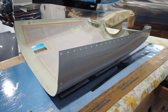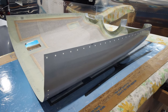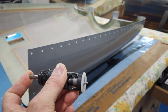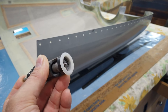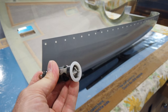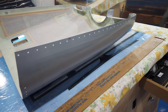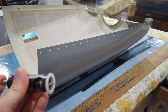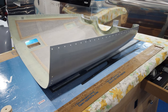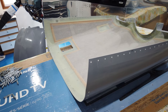There are a ton of holes to do on the cowlings. I was able to get through all of them with one countersink bit. The fiberglass will wear it down pretty quickly, but I was able to use a very small jeweler's file to clean up the edge on the countersink and kind of put a new edge on it once in a while — that seemed to help. Going into it, had I known, I probably would have bought an extra countersink bit because fiberglass does put a hurt on those.